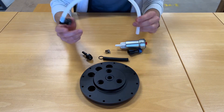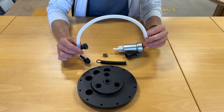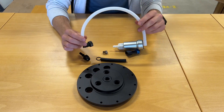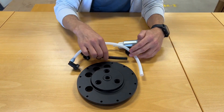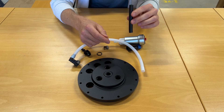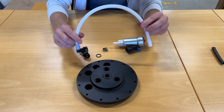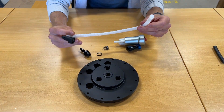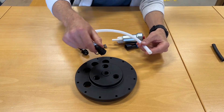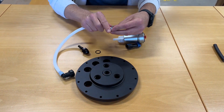We're going to show you how to assemble this PTFE fuel hose between the fuel pump and the fuel pump hanger. Instead of using the conventional rubber hose, which will eventually break when it's in-tank, use this PTFE plastic hose instead. You attach this plastic hose to your fuel pump and the other end to the fuel pump hanger.